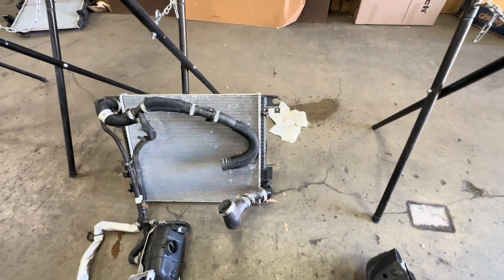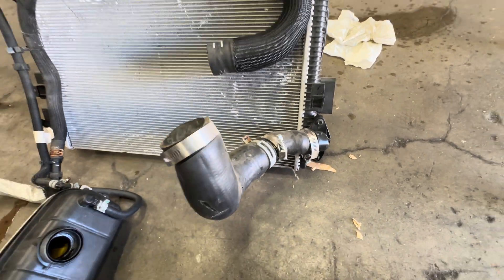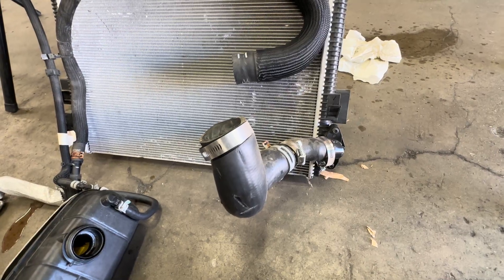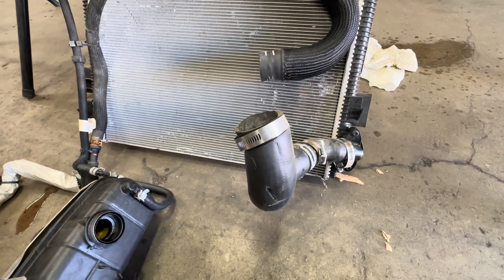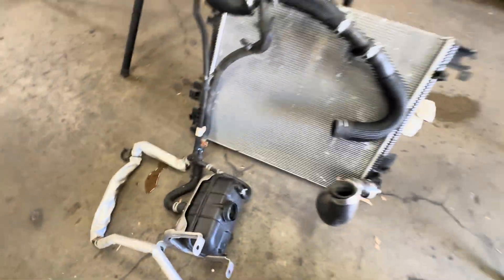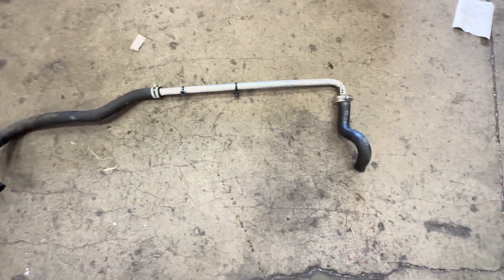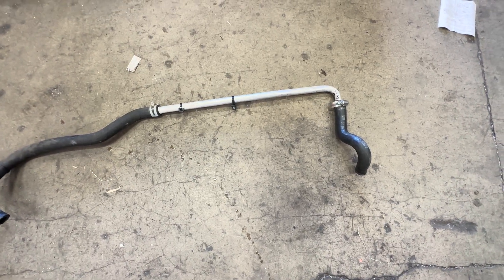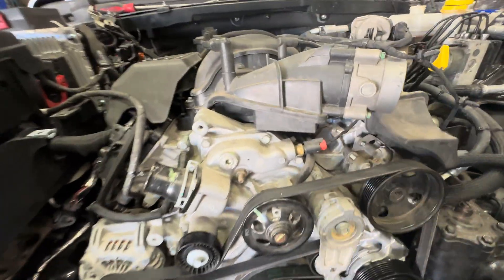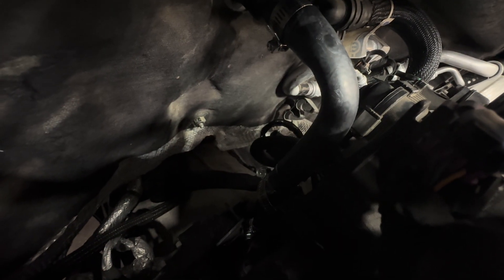I'm not going to say it's awesome, but it works. This is the lower hose — you've got to get an adapter that comes with the 392 JL stuff, but we just use regular hose clamps. This hose here goes to the heater core and the firewall, goes all the way around. This hose here goes from the water pump to the rear heater. So it would go from the front and then into the back tube, but it hooks up underneath there.